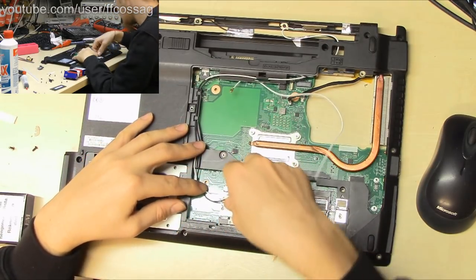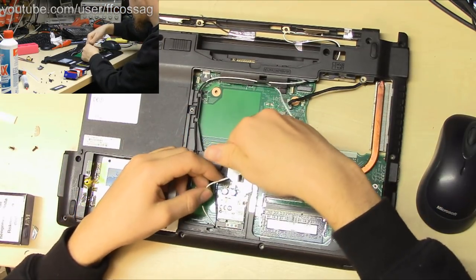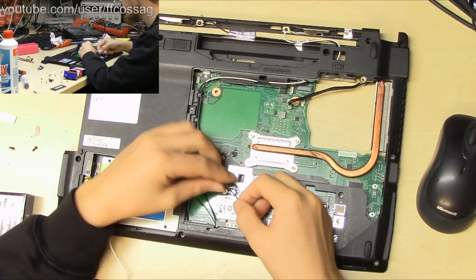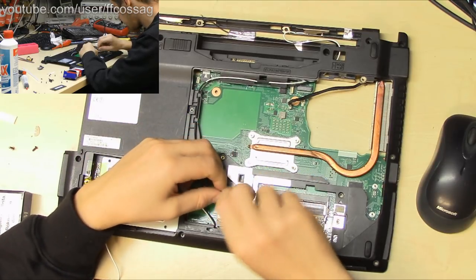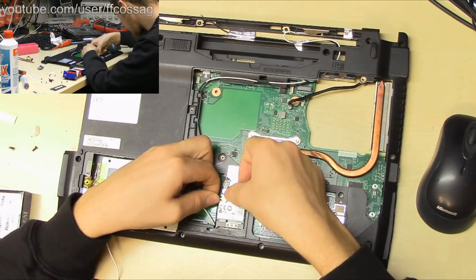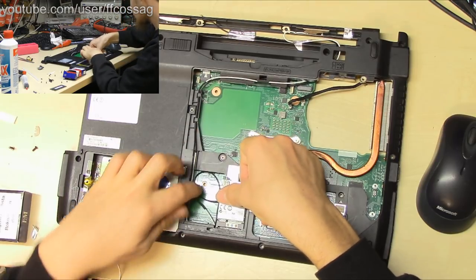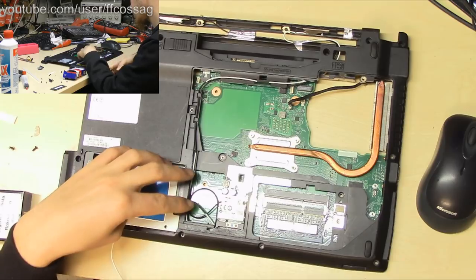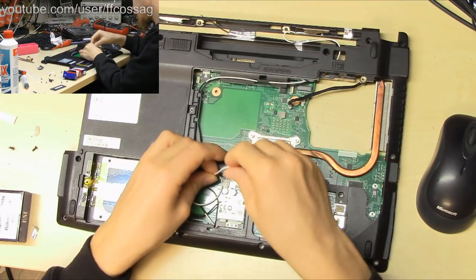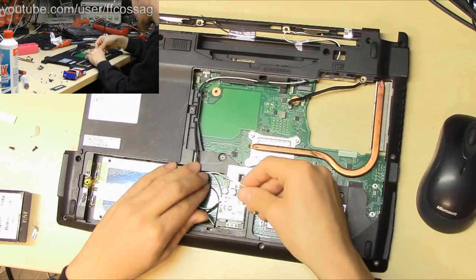I'll just coil these back and forth here until they're a suitable length. It doesn't require too much coiling, the black one's pretty much the right length already. It is kind of twisted though, which is not good because these connectors can't handle twisting very well. They tend to just kind of fall off if there's any kind of torque applied in the wire. So we probably want to tape this wiring down somewhere.